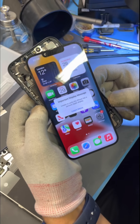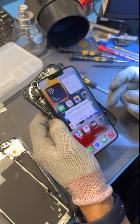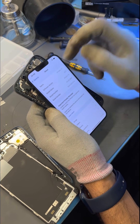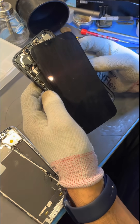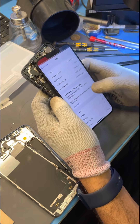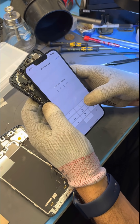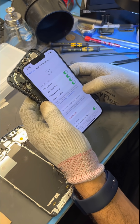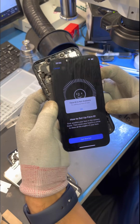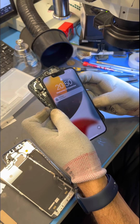The iPhone is displaying a non-genuine message telling us it's unable to verify if the screen is genuine, because it's reading a different code from the microchip on the screen. I discuss this in more detail in a blog post linked in the description — I've kept it as simple as possible. In the background you can see me accessing Face ID through the Settings app and trying to set it up with the incorrect screen. Face ID shows a message saying it's not available and tells us to try later, but we know that won't work.